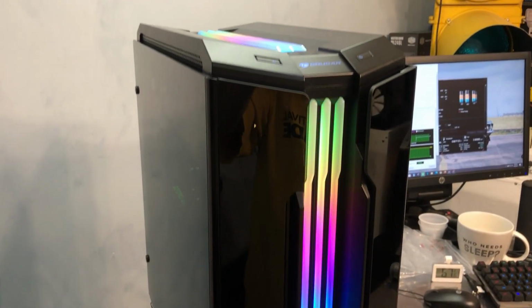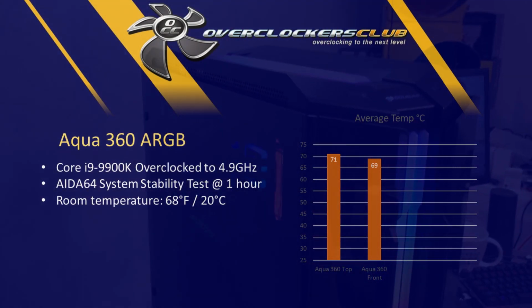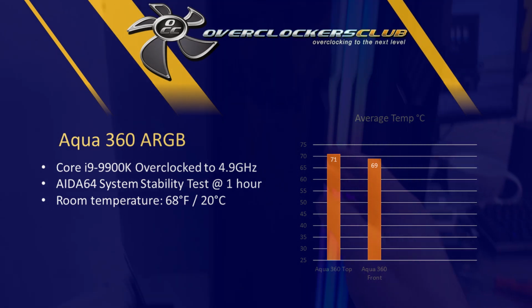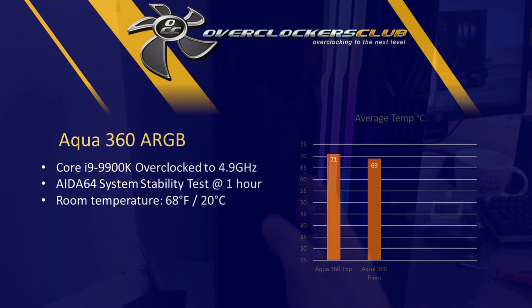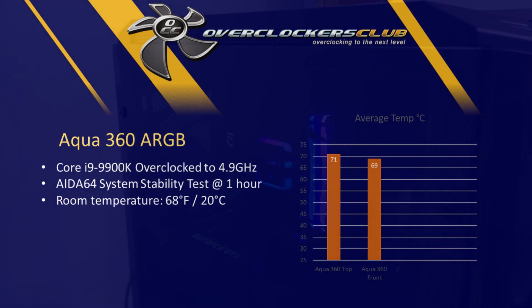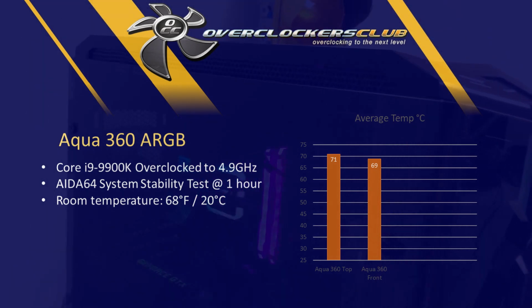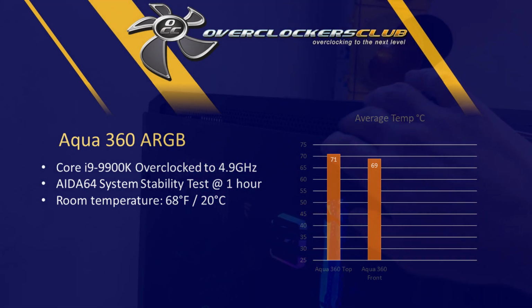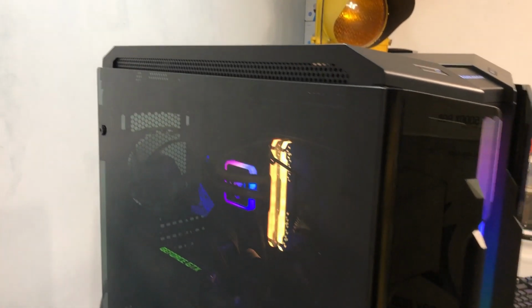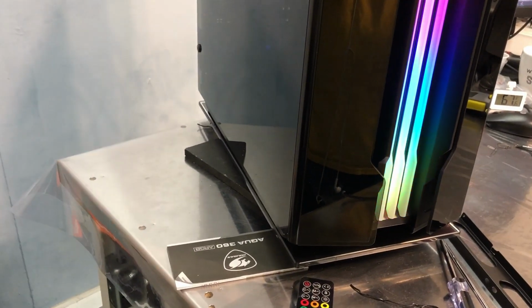Alright, so the overclock's been running a little while and I am seeing temperatures between 68 and 70 Celsius, so that tells me that the radiator in the front, pulling in cool air from the front, does knock a couple of degrees off of your temperatures. So it may be the fact that there's a little less restriction trying to push air out through the top when the radiator's in the top. Hard to say exactly what it is, but you do get a little better thermal results with the radiator in the front.